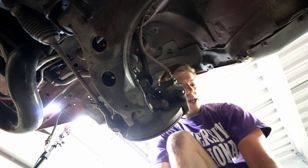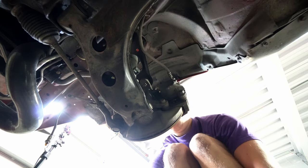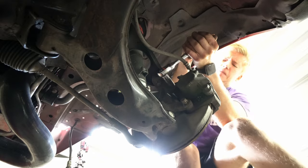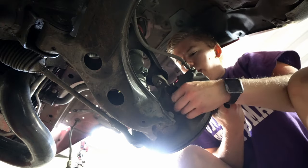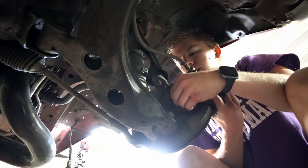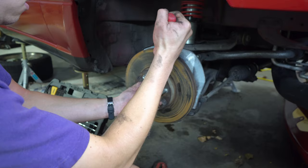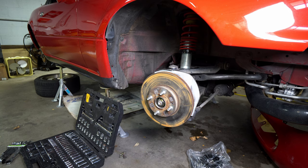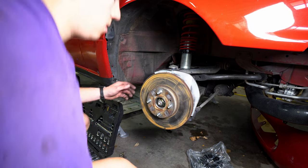Okay, that's a lot smaller. Two 14s because we need access to getting the rotor off, because we're freshening up the old rotarino — so we're removing the caliper itself. All right, set that aside. I think this is just a nature's loctite situation, so we should be able to give this rotor a couple taps. And she's free.